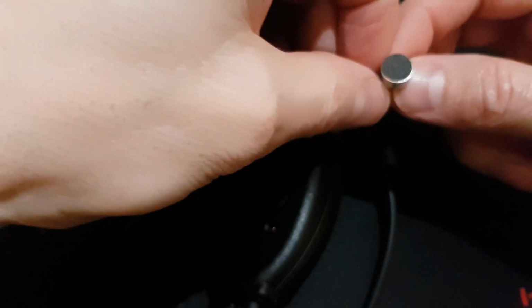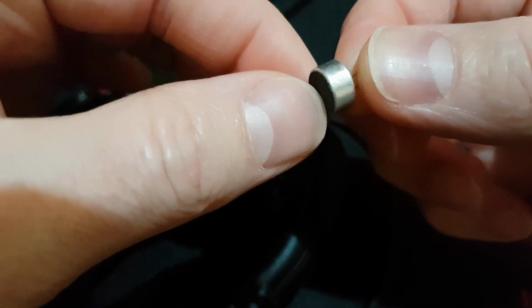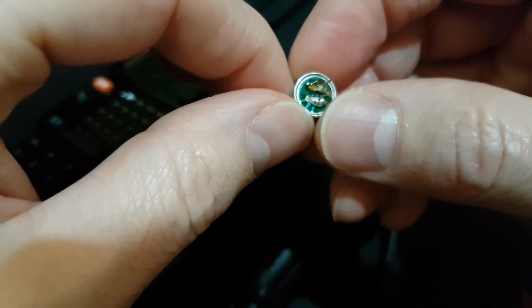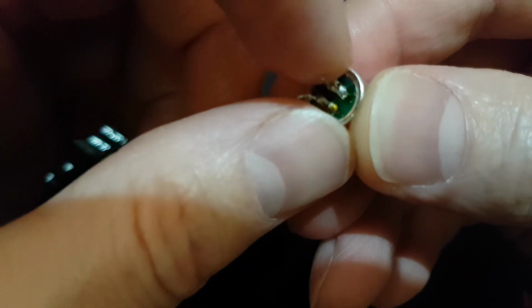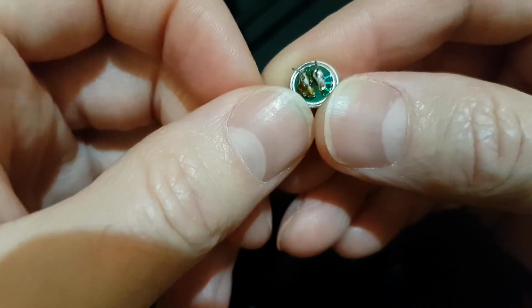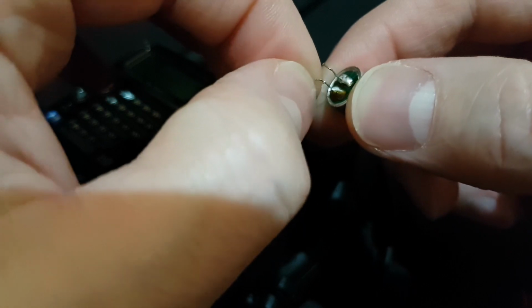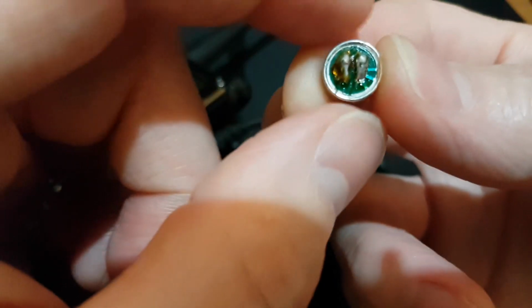So what do we need for this upgrade? It will be this little piece of microphone. Let me focus on it. Down below you will need to solder two pins, and you can mark this pole is negative or the ground, and this pole is positive. This is very important, because if you put this mic inside the PC board and the polarity is not correct, the audio will be very low. Okay, so positive is there, left side is positive, and these three lines are the ground.